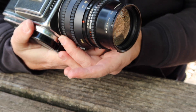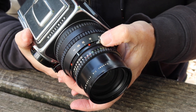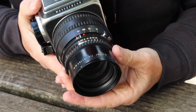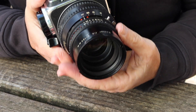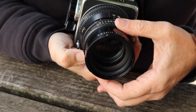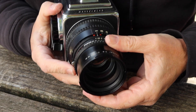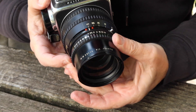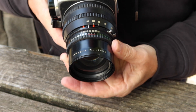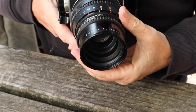On the lens we have a ring on the bottom just to give you leverage to remove and replace the lens. Next we have the focusing ring, and a flash sync socket located on the left side. We have a switch between self timer, X-sync, and manual. Then we have the shutter speed ring. As I'm turning the shutter speed ring, you have to adjust these two different things separately — it's kind of like the EV interlock system I complain about on the Konica 3A. There is an EV interlock here with this lever, and you have to pull this down to turn the rings independently. As you turn them, you can see the two orange depth-of-field markers moving in and out, showing you how much depth of field you have according to your focusing range.